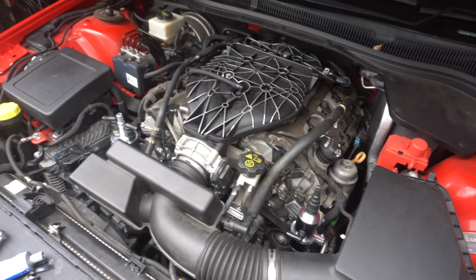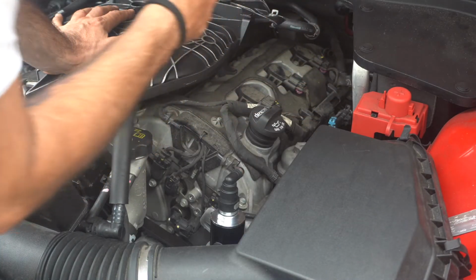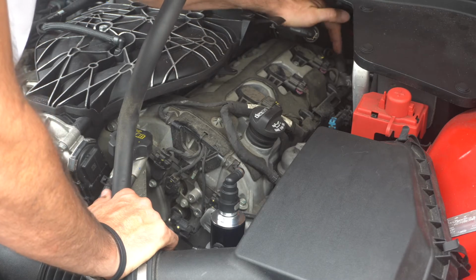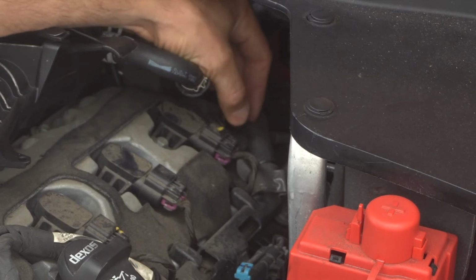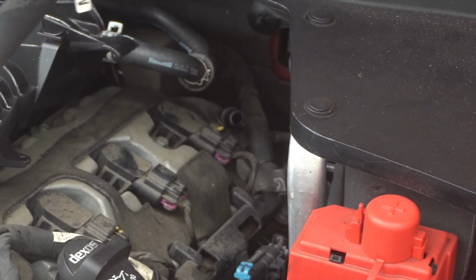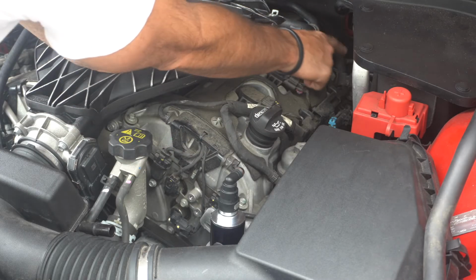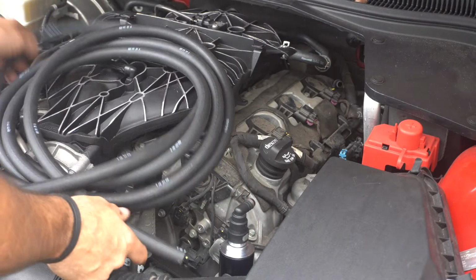So now on to the pipe work. I'll start with the dirty side. You're just pulling off your vacuum line here that comes to the valve cover. It's at the back of the valve cover. What's interesting is that it's quite loose in there, the factory kind of fitting that comes out. I guess it makes a vacuum, but I'll tell you what, it's very loose. Anyway, this unclips here off your intake box. I'll run a pipe from the valve cover outlet to the top of my mini can. Just going to measure this out.